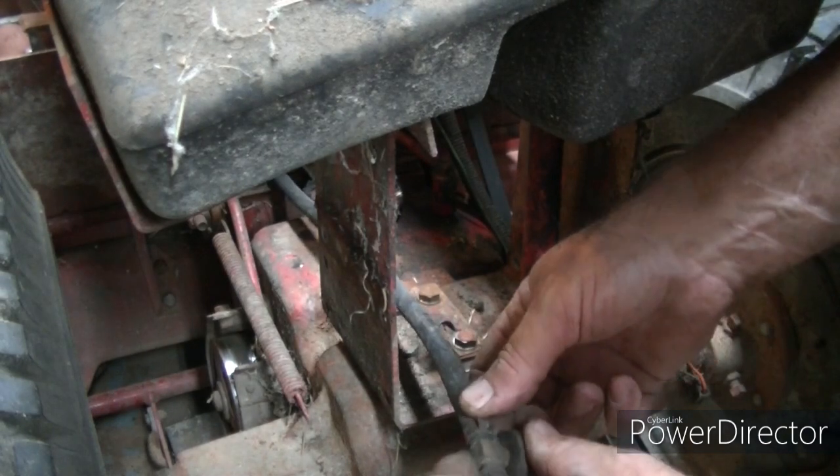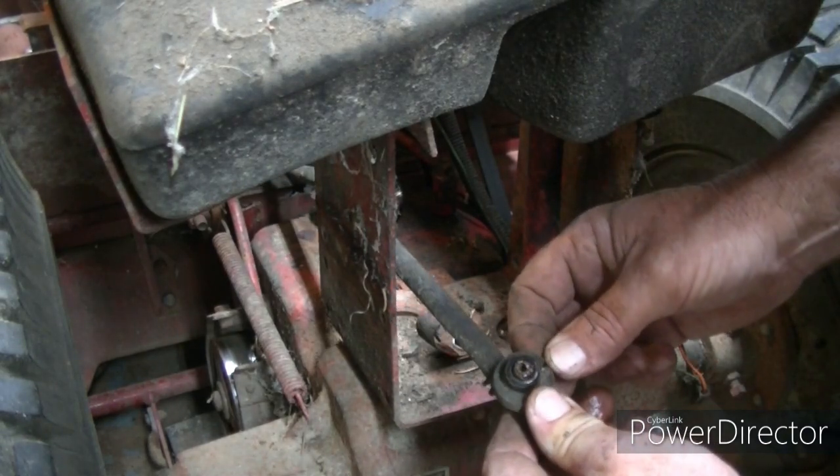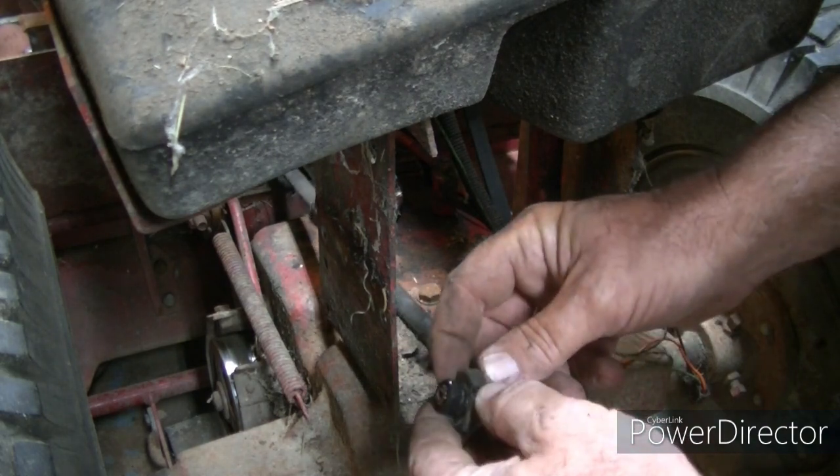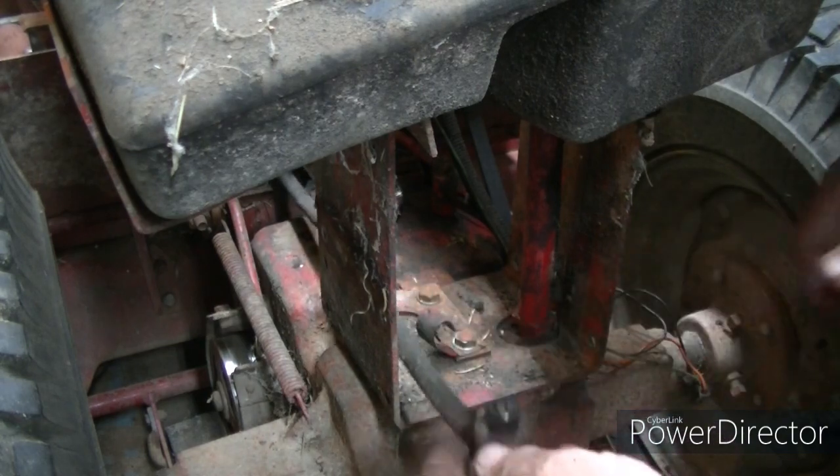All right, Mike. Take the rubber grommet off that hose first. Off the hose? Yeah. Oil it up, stick it in the gas tank. All right. A little bit of grease around the nipple, and you smack her in place. Otherwise all you do is rip that loop and try to put it in that way. It's already ripped.